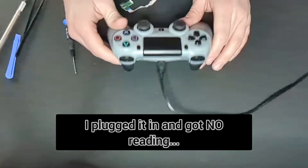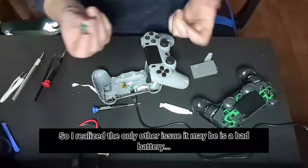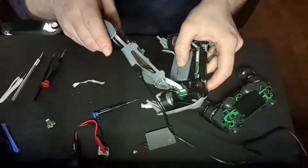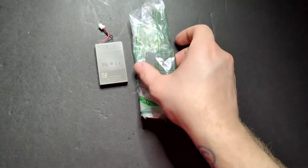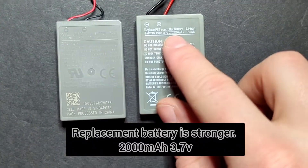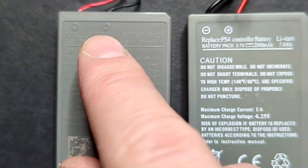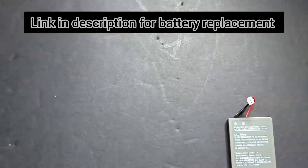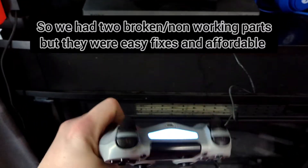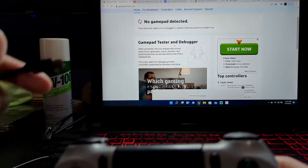I was a little frustrated at first when I plugged it in — I didn't have any reading with the USB. The only other issue I could think of was a bad battery, so I replaced that, and once I did that the controller turned on just fine. Make sure you check the battery model — they could be different. Also the port sizes could be different, so make sure it's the correct battery for that model PlayStation 4 controller. The replacement battery is much stronger than the old one so it'll give it a longer life. I'll leave a link in the description for the battery replacements on Amazon. It's a little frustrating that this seller didn't tell me about the bad battery, but I don't think that they knew — had they known they would have put it in the description.